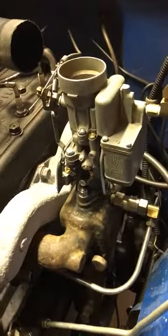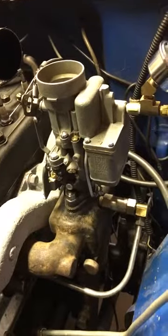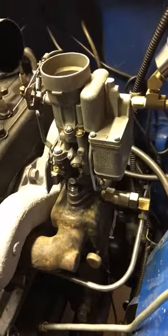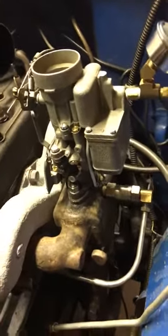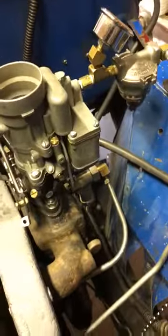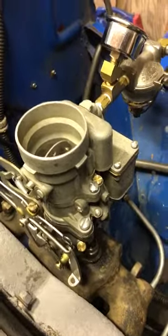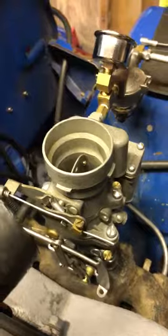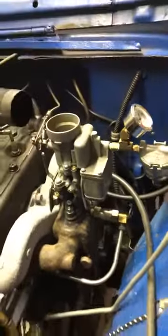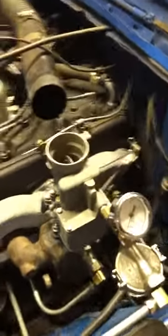Good morning Dave. We went round and round yesterday and I said okay, this is the best it's gonna get, I can't do any better. So that being said, I took it out on a test drive — it did okay for me. I was able to maintain 30 on a 4% grade in third gear, and she started bleeding off a little bit at the end. I think your car was just a tad on the old side, been around the horn a few times. So we got her back, she's been cooling — gonna go ahead and do that warm restart and stumble test for you.